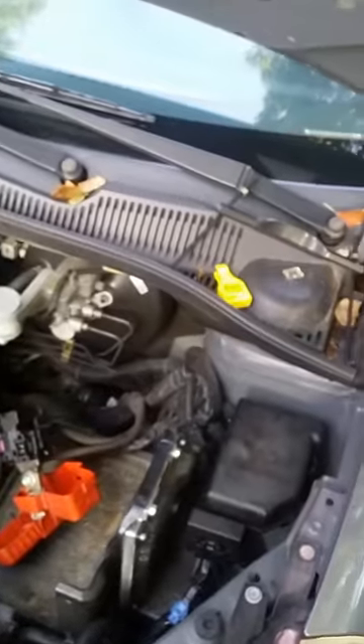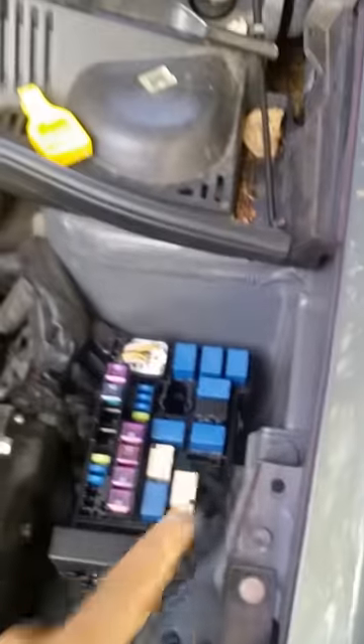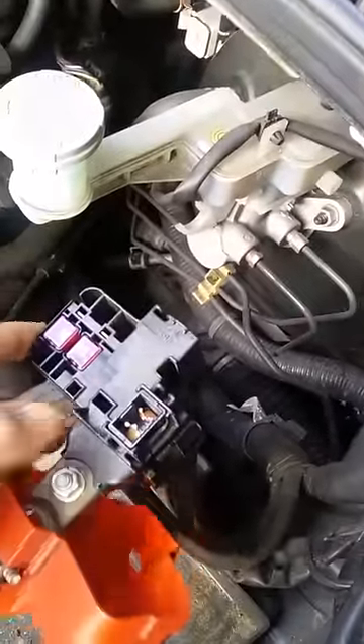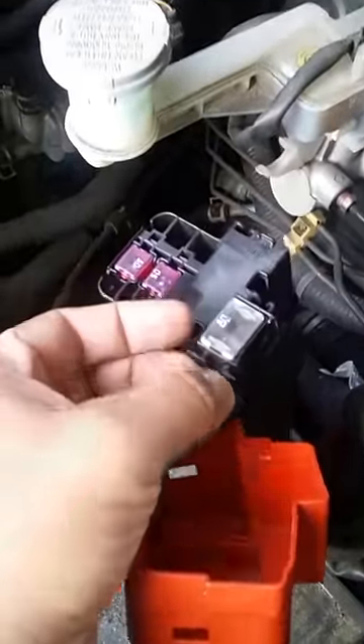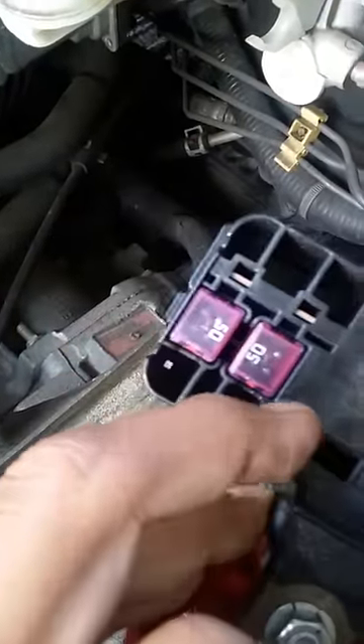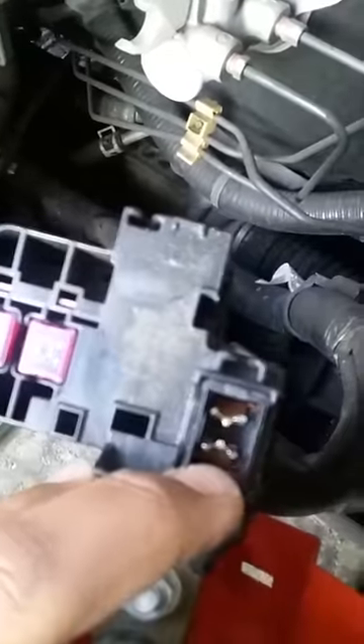The car turned on but nothing happens. I thought it was the main fuse — they talked online about the main fuse, which is this one. I replaced it and nothing happened. Then they were talking about the number 80 fuse that apparently is on the positive side of the battery, and I found it. That's the one — this fuse right here. It actually has a little cap. I destroyed it, and if you look closely you can see the fuse is blown — completely blown. There's a link, no link.